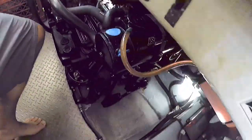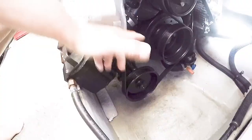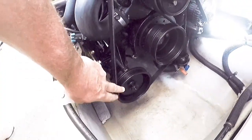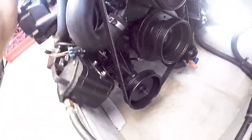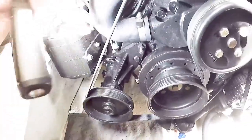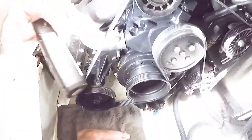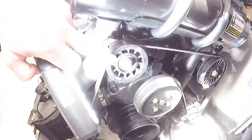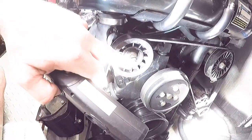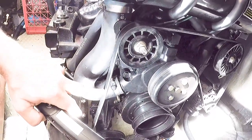Down in the engine room, the raw water pump is mounted on the front of the engine. Right behind this pulley there's a housing that's tough to get to. First you're going to need to release the tension on this drive belt, which is done by this tension pulley here — you loosen the outer nut and then turn the inner nut, and it moves the tension pulley down and gets the pressure off.